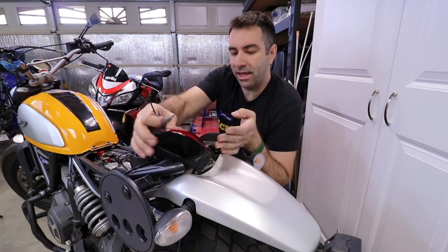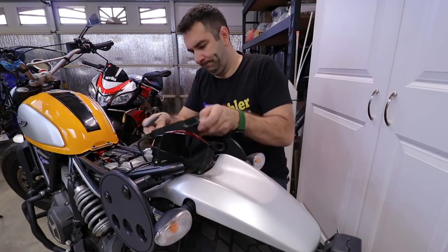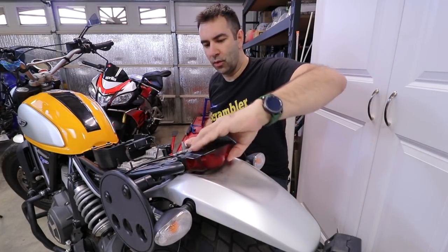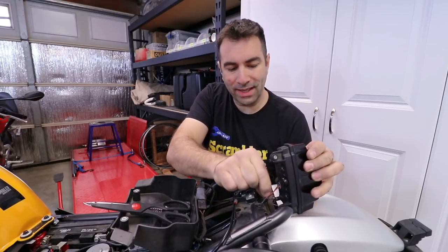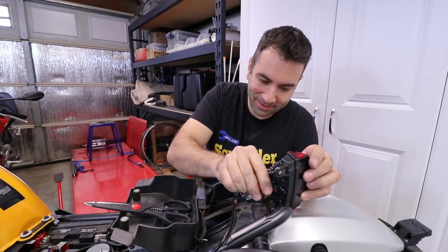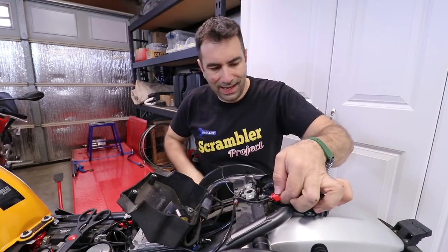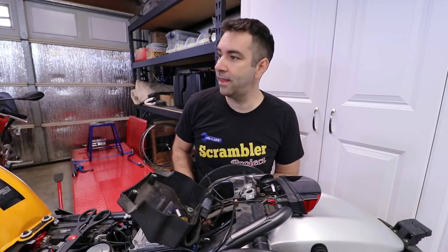It turns out it's very tight back here, so I'm gonna give myself some room by removing this little plastic piece and moving it aside. Now I have more room to play with those wires. Remember, if you decide to go with the rear tail light, the wire you actually need to attach to is the yellow one. Pass the provided connector through, push this metal thing in, then clamp the red flap across. Now it's time to take a look if that thing lights up.